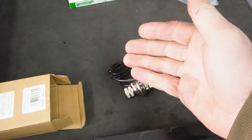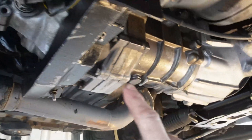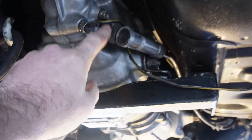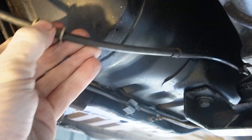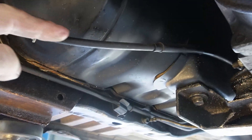So the first thing is to get underneath the car. Here we have our transmission — this is a Toyota W58 transmission from a Supra. Here is where the cable output usually is for the speedo drive. I've got a 90-degree fitting on mine because of space constraints. Coming around here, this is the cable that goes all the way up to the dash.